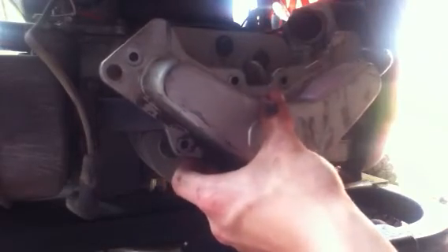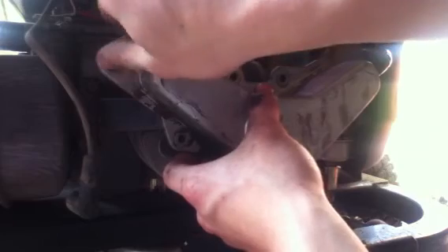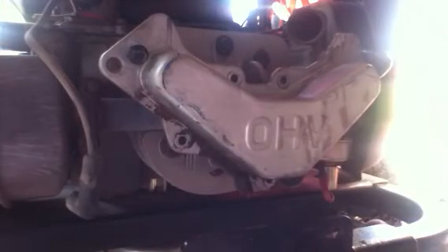For most engines, the torque on the valve cover screws is usually around six foot-pounds, so that's what you want to look for. Since I don't have a ratchet here, I'm just putting them in a crisscross pattern and torquing down to six foot-pounds. Also replace your gasket if needed — on older mowers the gaskets can break down. There's no compression on that gasket, so if it leaks oil, that's when you'd replace it.